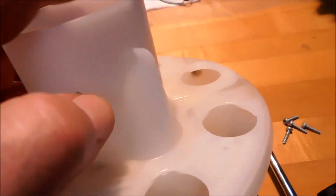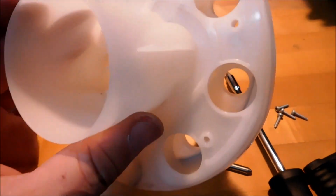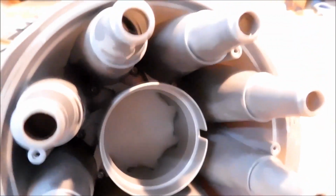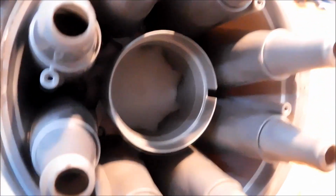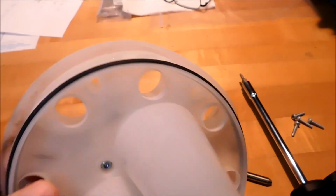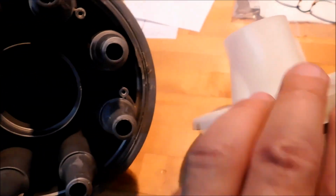And there's a little protrusion on the bottom of the subassembly. Make sure that when you feed one onto the other, that you align this rib right there with that split right there. There are some sealing surfaces going on here, so make sure that once it's lined up and seated, that all eight of these venturis here pass through these openings and gently push the thing down until it seats against the standoffs that are going to hold it in place.